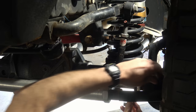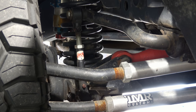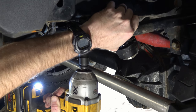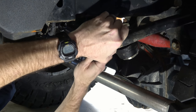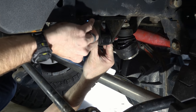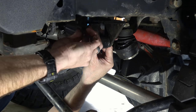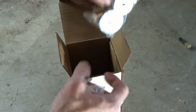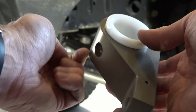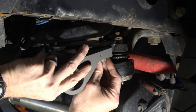So once you drag all of those shiny parts out of the box, the first thing we want to do is remove the existing sway bar if you have one installed and the links. Now you're going to remove the sway bar mounting bolts from the frame, but you need to keep those — that's actually the one thing that we're going to reuse. You will also notice I have the steering stabilizer relocation bracket, which is also an ORO product I did a video on previously.